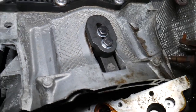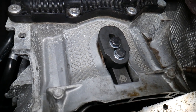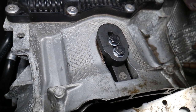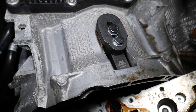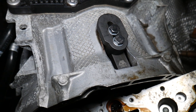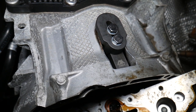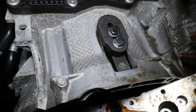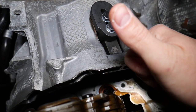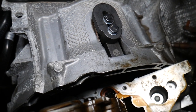Once you stretch it all the way back, get the two bolts tight - not by hand, use a wrench. I'm doing it by hand only because I'm lying with one hand under the car. That's how you install the flywheel holder tool, and then you're ready for removing the flywheel bolt. Hopefully this video is helpful to anyone with a Z4 or X4 with that 2.0 engine. Thank you for watching, please subscribe for more videos, and see you next time.